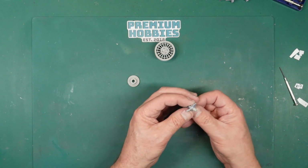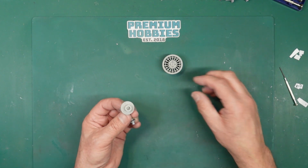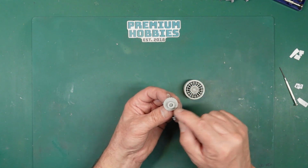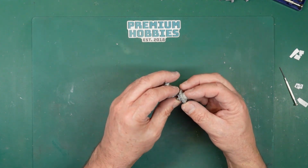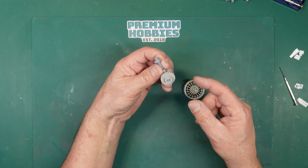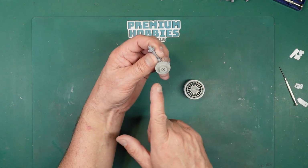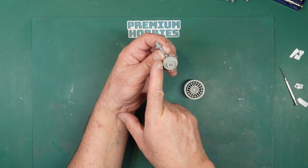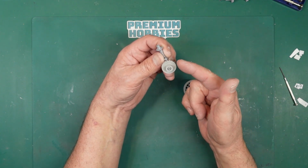We've got the front left here. I've marked the wheels up and you'll see why in a minute. And then the disc goes on. And make sure you've got the correct disc. The way the groove should be, I saw the way Brembo described it was better than me. I would say it has to go into the pad. Basically the way they describe it is the outer edge of the groove should hit the brake pad before the inner. So basically it's chopping into the groove.